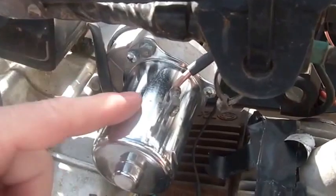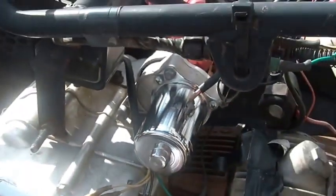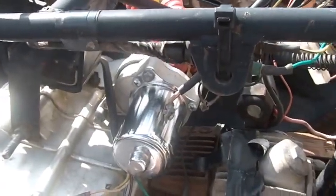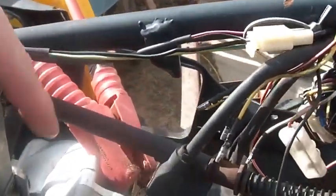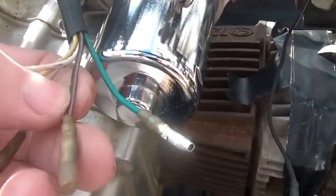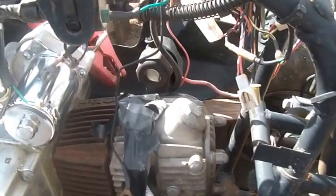I like applying power externally to the starter as I showed you. If these wires are isolated and covered so they can't touch ground and spark, should the engine fire up, I don't have to worry about blowing anything up — it's all disconnected. I don't have to worry about giving the voltage regulator a hot foot, or hacked-up wires smoking, because the only electricity being applied is to the starter. Once it starts, I'm not producing electricity except through the black and red going to the CDI unit, and typically that's not enough power to cause trouble. Questions, folks — please ask. Thanks for watching, commenting, and subscribing.